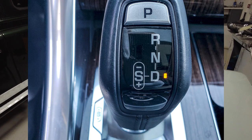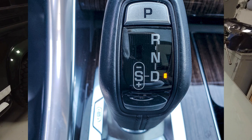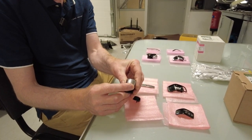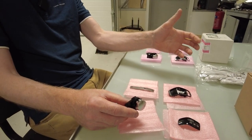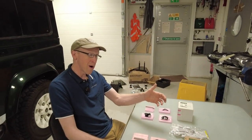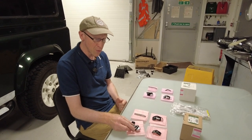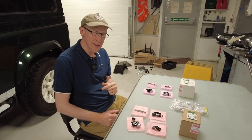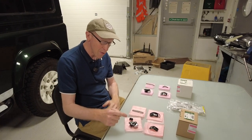We're looking at the Range Rover Sport L494 gear knob. On the back of the gear knob there's a little button, which is a safety catch so that as you change gear to come out of park, you have to press it. Some people have a problem where they cannot select gear — they can move the gear stick, but unless they press that button they can't select gear.